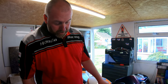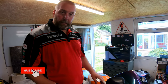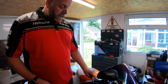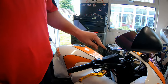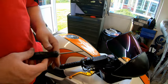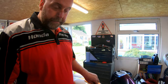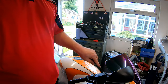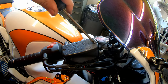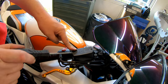Before we begin, I'm going to drain the fluid from the system so that we can crack the lines off and we're not going to be dripping brake fluid all over the floor. As you can see, these two screws don't look too clever. This is a JIS screwdriver, which is Japanese industrial standard. I'm going to hazard a guess that the previous person that tried to remove these screws used a standard Philips, and this is the kind of thing that happens when you do that. Japanese sports bikes use the JIS standard for their screws, so that's worth bearing in mind.